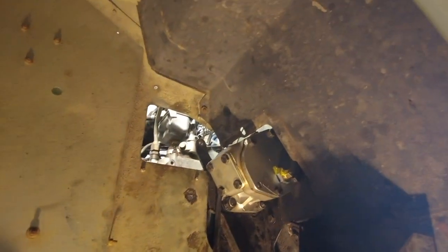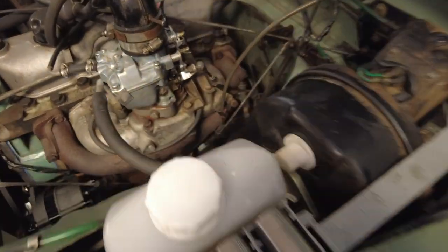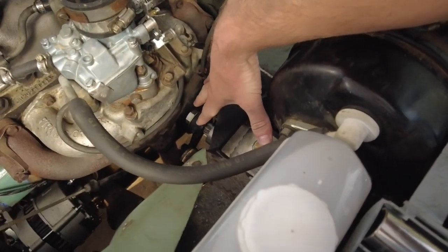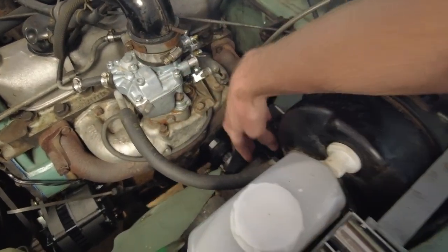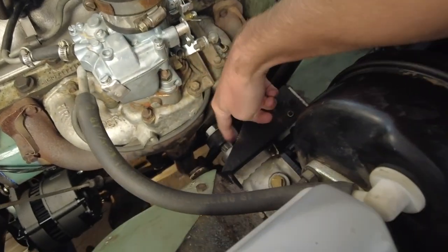You can see up here the brand new one is installed. We've got to put the cover back on and tighten up all of the frame bolts. Everything fits up real nice with the bracket. These shims up here were extremely difficult to put on. For alignment, we had it at full driver on the steering wheel, made sure the steering box was locked out, connected it, made sure it worked good, and then put it on the spline.